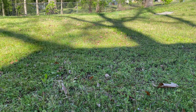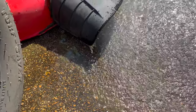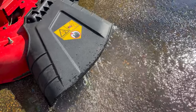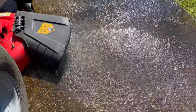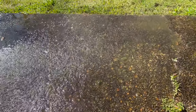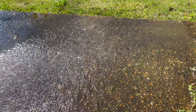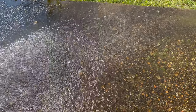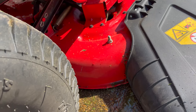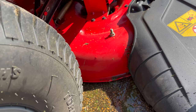After a quick cut, a quick deck wash. I'm getting rid of the fall dust and anything else added from this mow. Anyone that thinks this isn't a good idea needs to look at how much green muck is coming out. That's not algae in the upper right-hand corner on the concrete — that's grass. That's grass that was on the underside of the deck. Look at the deck lift — you see that green slowly oozing out? That was all on the inside.